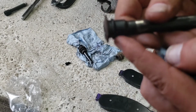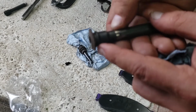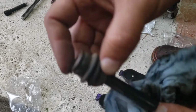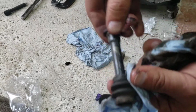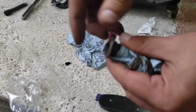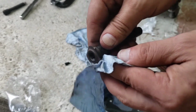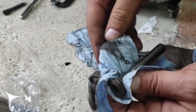I'm going to go ahead and hit this little ridge right here with the wire brush, or my wire wheel. Get all that crap out of there. Some old boots. I had to buy a whole new parts kit for the other side. So I got brand new stuff on the other side. The only thing I have against that is it always gives me different size bolts. So the next time I go to change my brakes, I have to come out with a 13/16 on one side and I think a 16mm on the other side.